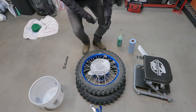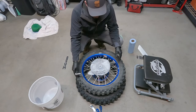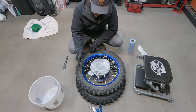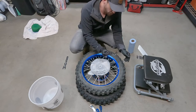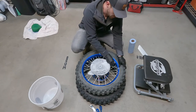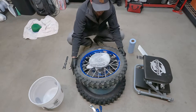All right, so as you can see, I've actually temporarily swapped out the bucket for resting the tire on my new tire. That's because when I'm breaking the beads, I just like to have a little bit more stability on the ground. But before you do that, you're gonna wanna go ahead and grab a 14 millimeter or whatever size your rim lock is. On most Tubliss systems, it should be 14 millimeter, and just get that guy loosened up. It's time to break the bead.